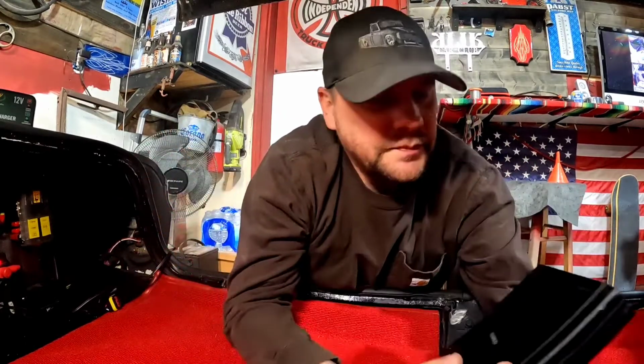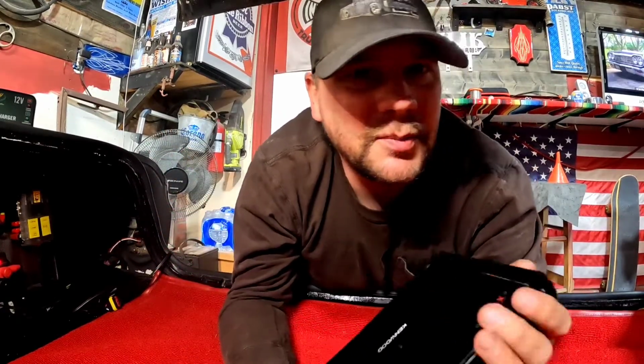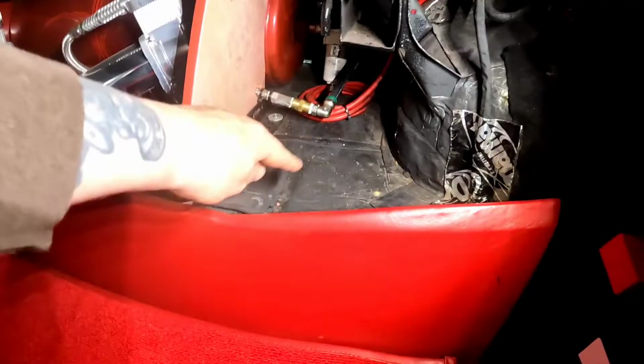They're JL8W3 V3s. Boxes are 0.35 cubic feet tuned to 35 hertz. I have this Kenwood Exelon XR601. It's a pretty small amp. I should be able to find a place for this somewhere. Look right there.